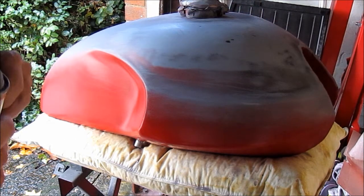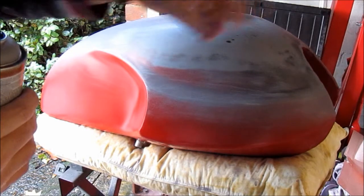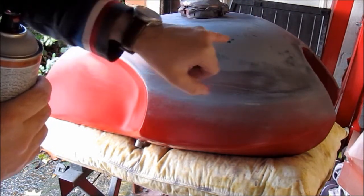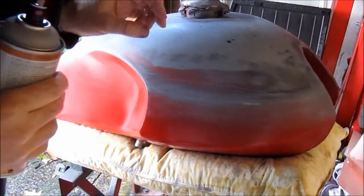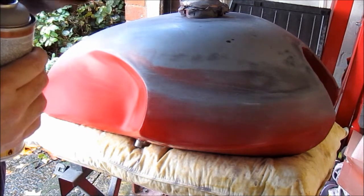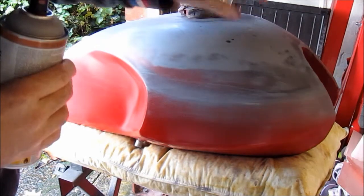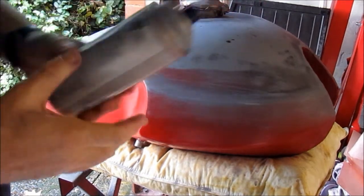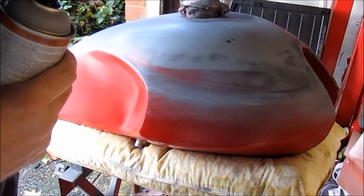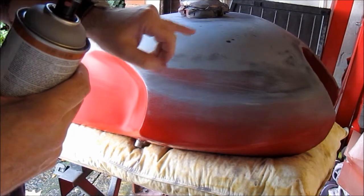The dents are very shallow and difficult to see, so I used a very light coat of black paint first and then rubbed it back to show me where the hollows were — I've got one here and one just there. These two small dents aren't the fault of the maker; it's my fault. I think I must have done this when taking the tank off and on the bike, knocking it against the clip-on. To solve this, I've been using filler primer rather than standard filler, spraying it over and over again, slowly building up the filler in this area, then rubbing it down again. I'm getting there now — there's not much left.